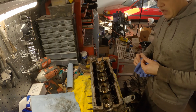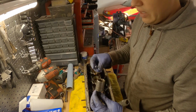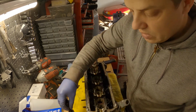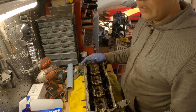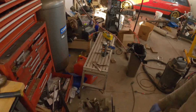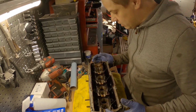Okay, well, I may have lost footage, so that's annoying. The SD card didn't catch it, but just use a socket and a little magnet: put the magnet on, socket on top, hit it, keepers come out. It's been done. You can check it on YouTube. Hopefully I still have the footage, because if not, I'll be really annoyed. So yeah, anyway, the boy is not happy. Mommy's not here. Yes, I said mommy. You know, he's like a child.